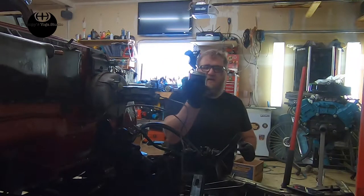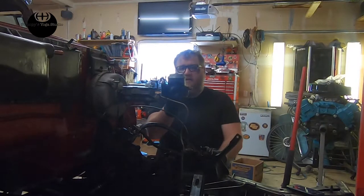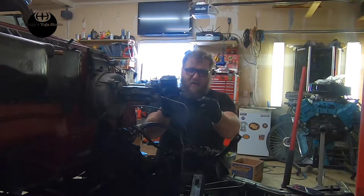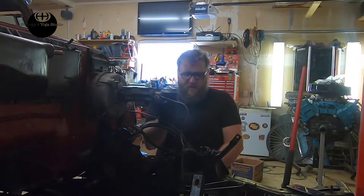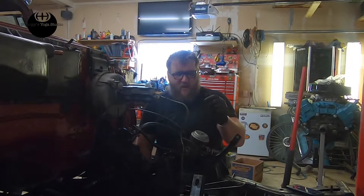this car had a master cylinder that looked like this. This is a single master cylinder. When you hit the pedal and push, all your fluid comes out here, goes into here, goes to all four brakes in the same amount, because this had four-wheel drum brakes. Not the safest, but it was what they were doing then.